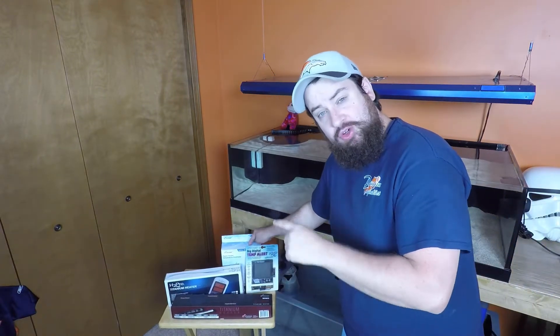I'm going to bring it in a little closer so you can see it better. Here we have the temperature probe reading, and this is what your heater is set at. We can do Fahrenheit or Celsius — to change that, all we do is hit the plus button. To set it, we hold the set button until the bottom number blinks, then go up and down to whatever temperature you want, and hit set again to set it. This doesn't have a high alert, so it's just telling you exactly what it's at and what your set point is. You get the decimal on here, so you can see exactly what your aquarium is reading. It does have a plus or minus of 1.8 degrees, so it's nice to get readings like 77.7 or 77.9 — as close and accurate as possible to what your tank is reading.